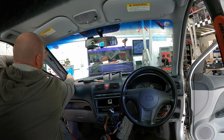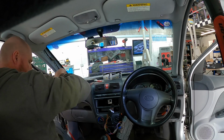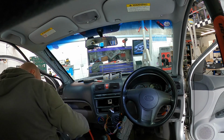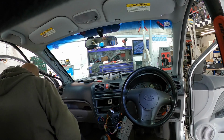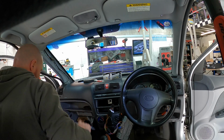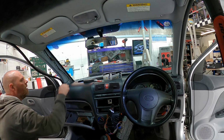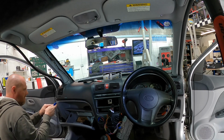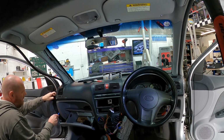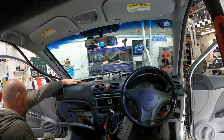So there's our cable taped up, fixed to the A-pillar trim, and this is what we've got left with, is power and then obviously our microphone. Remove our test lead now because we know where the power went. Open the glove box out because we're going to go down and across the back of the dash and then up into here. We have got an access panel on the side here, which I am going to pop open because it's going to show me a little bit more info as to where the cable is going to be coming through the dash. Let's move that aside.